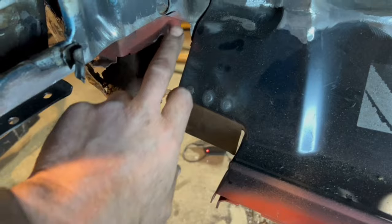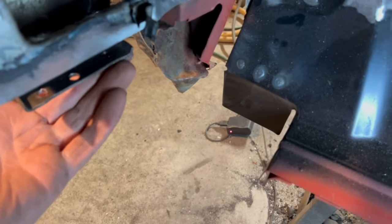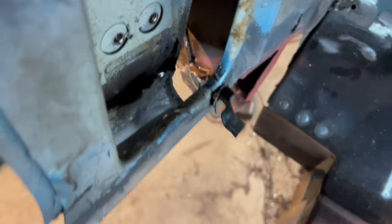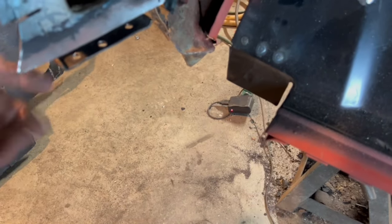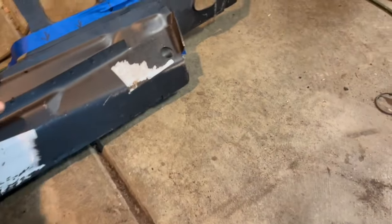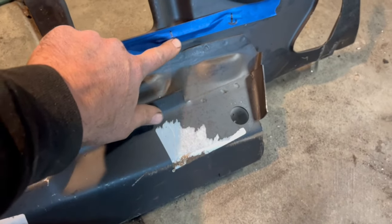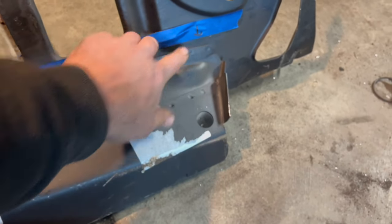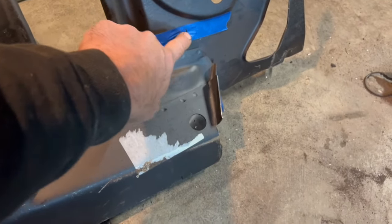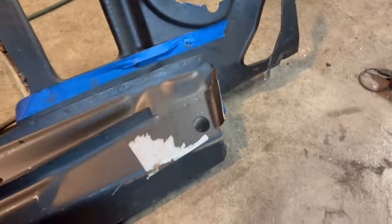This is the inner cowl — I've cleaned it up and wire brushed it. This is the weld-through primer I like to use, and you can see there are three holes drilled in that flange. I'm going to try to weld down through here and do those plug welds back into place — I feel that's a lot stronger if I can get them to work. If not, I'll just weld the outside edge back into it. I've got my transfer over here. The arrows are there for a reason — if you know why, hit me up in the comments. I'll slice it here, cut it off, get it ready to go. The hole is my point of reference — the six o'clock spot on that, shoot over at about a 30-degree angle, and that should get us ready.